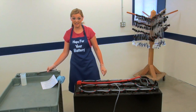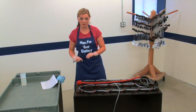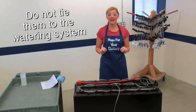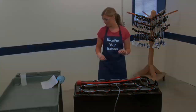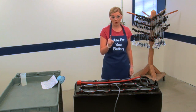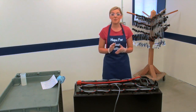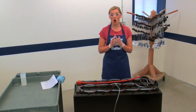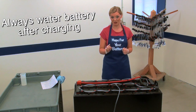It's always good practice to tie down heavy gauge battery cables. However, do not tie them to the watering system, as the tie-downs may restrict water flow. The system is now fully installed, but one important note: you have to wait until the battery has completed its next full charge cycle before watering. Always water the battery after charging.